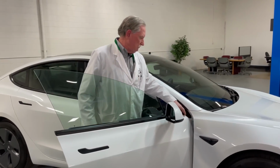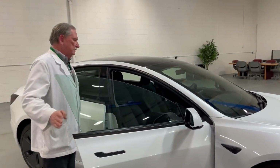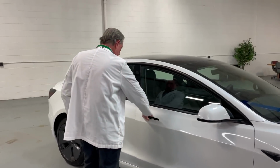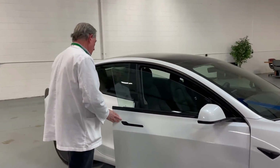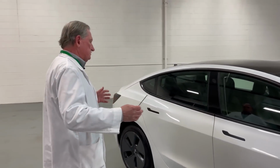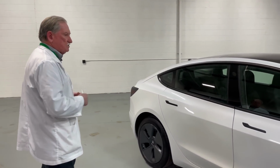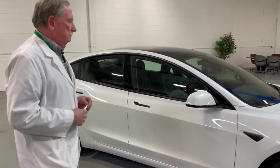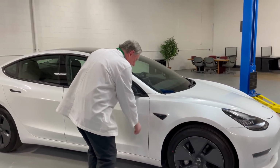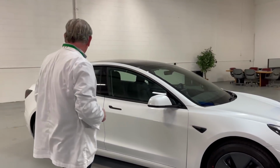So let me just find out, because that's so close. Well, they didn't. But that's so close that my guess is that it would kiss, but it hasn't. So we need to, closing efforts are harder, which I don't understand because the closing efforts used to be really good. So I can see that around here the gap is quite large, and then right here you can tell it's like there's a big 0 here. And this, whoops, that's so tight it's grabbing my little gauge tool.